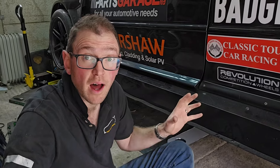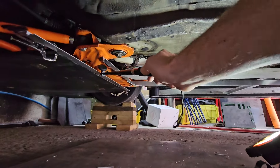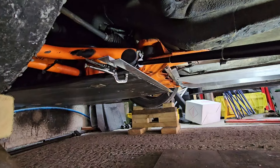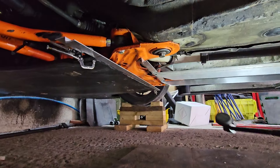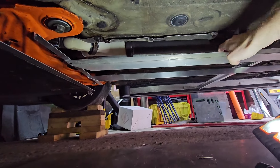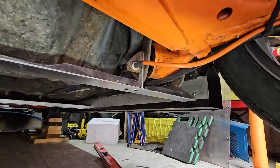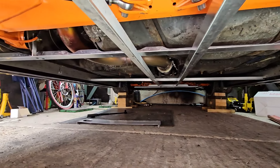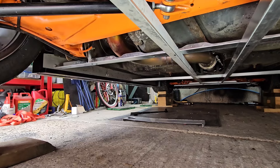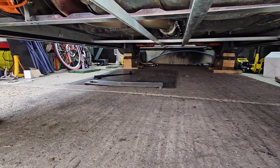I'm going to flip the camera and show you what I've got so far. We've got a bit of a framework on the go. If I told you this represents six hours of work, you'd almost certainly think I was lying. I'm going to use this selfie stick as a pointer. So we've got a Z on the back of the splitter — that is a Z profile, 12mm thick, the same as the splitter, so that is then flush. The floor will lap on top of that and bolt through it. We've then got another Z slightly deeper on the subframe, where the subframe's a different height, holding our channels, our rails. We've got an intermediate here attached to the centre exhaust mount, and another intermediate here on little tabs hung down off the beam. Profiled over the fuel tank, over the exhaust, over everything. All of that framework is flat and level, and that ties in with the bottom of the skirt support. We've got a 20mm rake front to back over the whole car. That is the basis of our floor, and this is our first test piece of floor pan to go on.